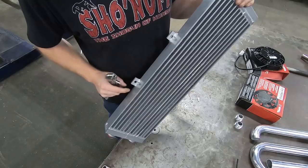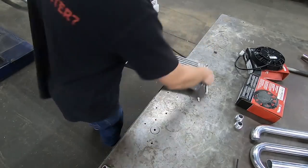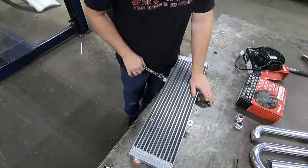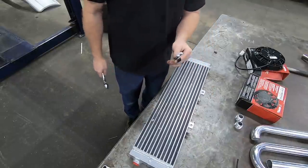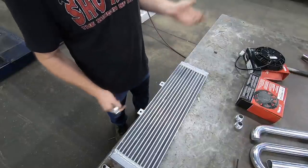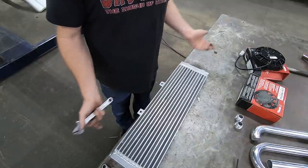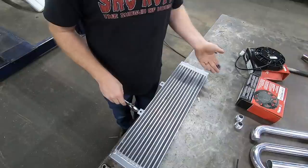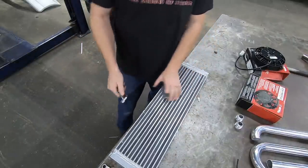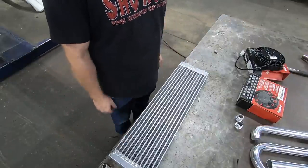I barely pushed on one and see - they're only kind of welded on the front side here, nothing on the back. So that's an open seam on aluminum, and aluminum is very very easy to break off when it's an open seam. I just got a pair of channel locks tightened down to the tab size and very gently push down and it breaks the welds right off. They didn't go around and finish the whole joint - they did the front to give clearance for the bolt and the back just for a clean line finish. It's still strong enough to hold the radiator, but I didn't like where they were. I'm going to snap these four off, clean up the welds, clean new spots on the other side, and weld on some new tabs.